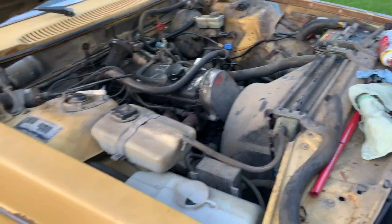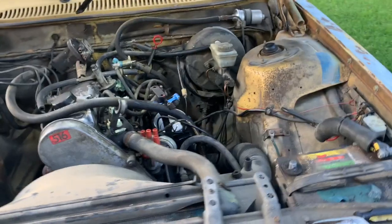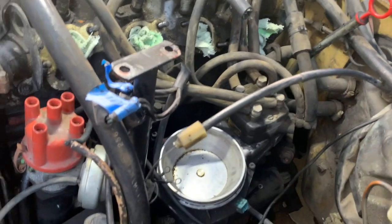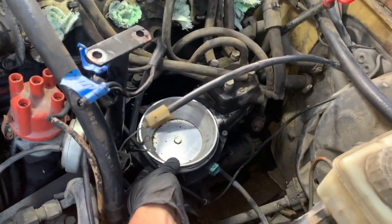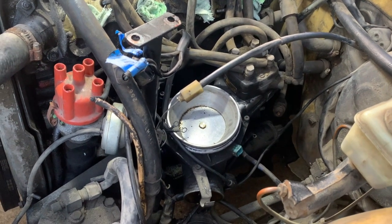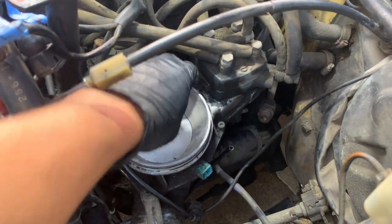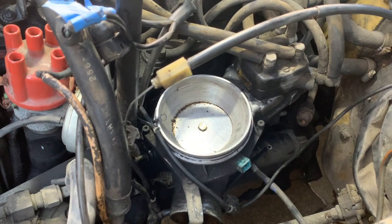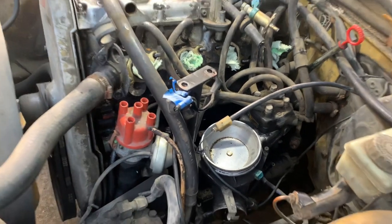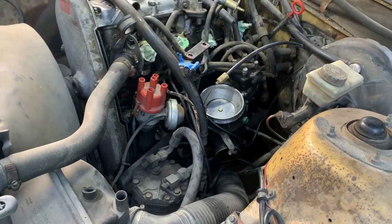But yeah, that's just a short update on the '77 242 here. It was running up to that point. The intake boot here had completely torn, and I think it was because whenever the engine's on, this was flexing, it would tear on that rubber, and eventually the rubber tore completely to where the airflow sensor couldn't read any vacuum, and then it stopped running. But we're going to clean this up, and hopefully I don't mess anything up and everything gets back where it should.